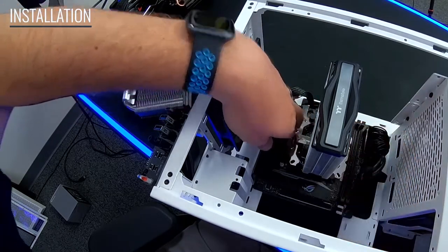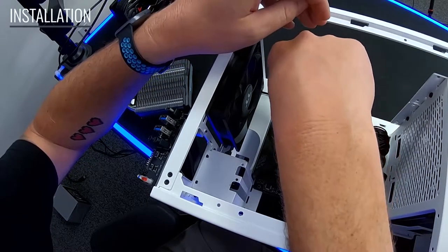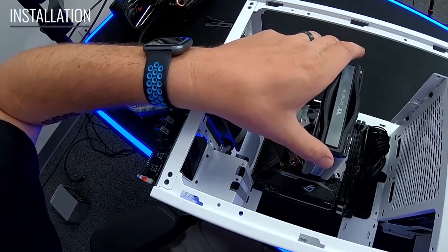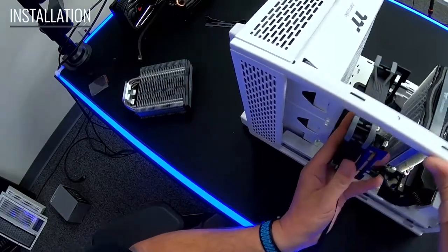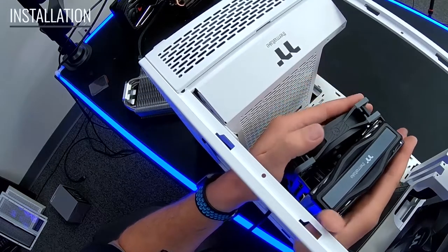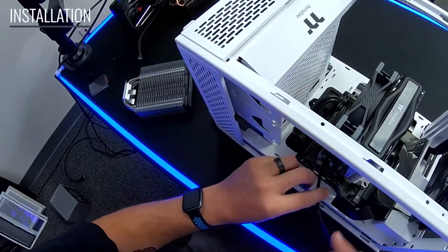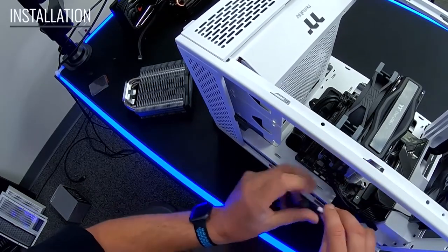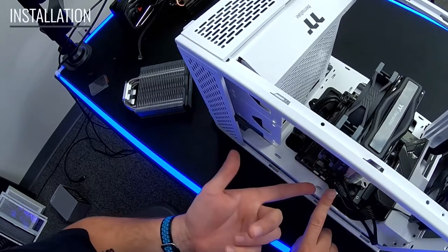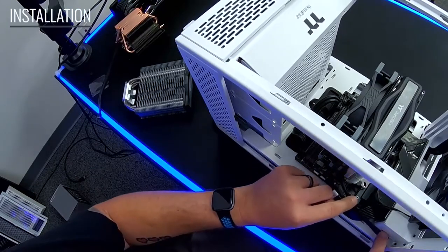I'm going to line this up and you can use your fingers to kind of get one of them started. I'll come in here and all I'm really trying to do right now is just get the threads to connect, because this is where you're going to have your tension for the cooler mounting on top of the CPU. You'll also have a little bit of play here so as you're tightening down just make sure it fits in there just right. Then we're going to take our fan — I'll put a hook on one side, hold it with my hand so I don't put pressure on the bracket itself, and that's all there is to it. Then we'll tuck the fan cable in here and plug our fan into where our stock CPU cooler header is to get PWM performance.